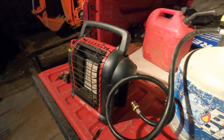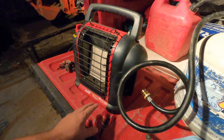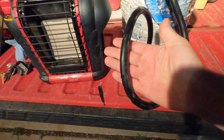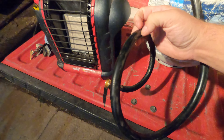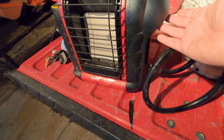In this video I want to show you some of the issues people are having with the Mr. Buddy Heater from Mr. Heater when using a bigger tank and a hose line. Most of the issue comes from the oil that comes out of these cheaper lines when they're under pressure for a long time. When the line is pressurized too long and the heater is off, it pulls and extracts oil out which goes into the heater and ends up clogging the system.